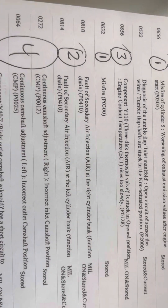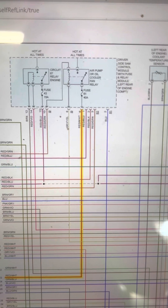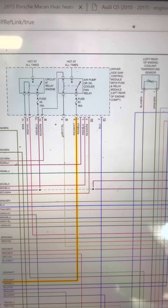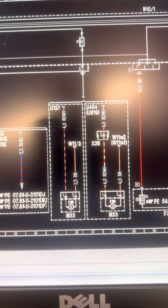When you see both banks, you're looking for one common denominator, and that being the pump. This is Aldata's simplified diagram. You can see that the relay is relay R, and it then powers Fuse 61 that travels to that air pump. The factory tool calls that air pump M33.